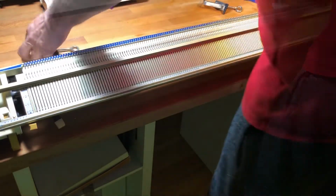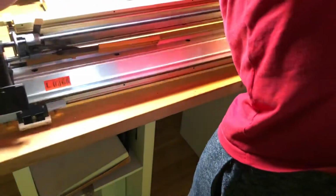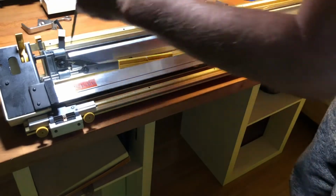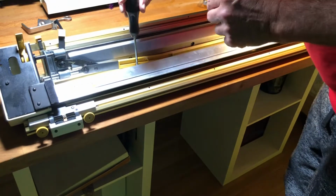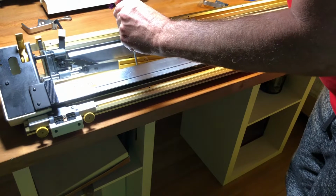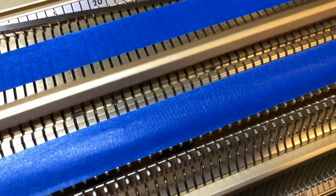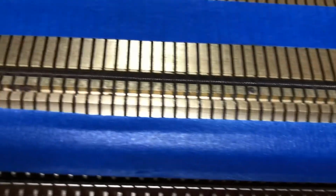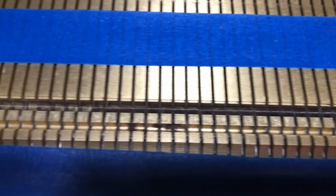Then turn around the machine on its back, and you see those holes in there and this aluminum cover, and there are the screws you need to loosen. Be aware that the screws don't come out completely. As you remove that top rail, you can see that needle brake spring. Oh man, it's dirty, it's covered from grease.